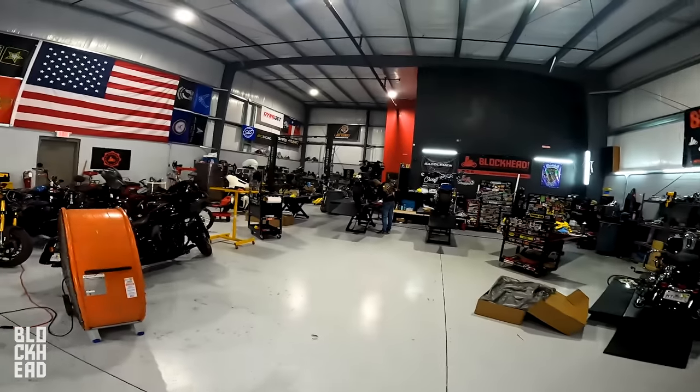He's tuning out all the decel stuff. The 590 cam — we've got an S&S 590 cam in it, which is an incredibly high-lift cam, so the bike performs really well on the top end. It's essentially a race cam: really high lift, the valves stay open a lot longer so you're bringing in more air, and the exhaust duration is a lot longer so you're pushing out more exhaust. If the tune isn't just right you get that overlap — the valves are still open and that's where you hear the backfire, which has to be tuned out. It's actually progressing a lot since we first started.